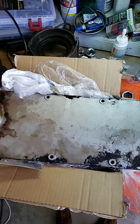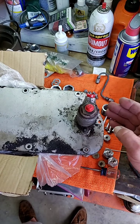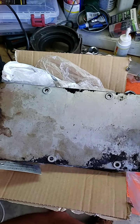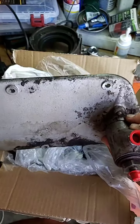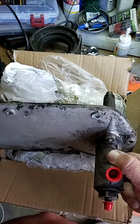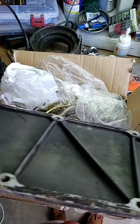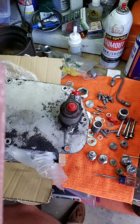What we're looking at right now is a Rolls-Royce brake pump. These are Rolls-Royce brake pumps — this is what sits on top of the engine. These are the brake pumps right here; this is what pumps the brake fluid up into the spheres to give it the pressure. This is the underneath of it — these sit on the camshaft inside the engine, and as the engine turns it pumps.